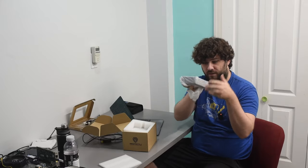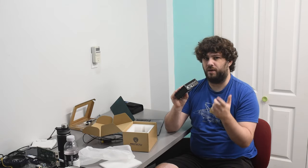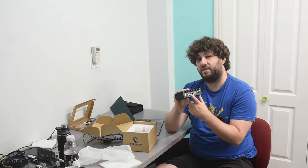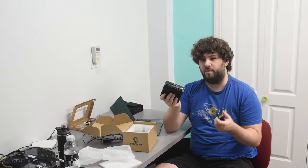Here it is. It looks pretty much identical to the FW-4B I've been using for a few years. It's got a 12 volt DC barrel jack and four RJ45s. This one has four Intel i225 v3 two and a half gigabit NICs. The slightly cheaper FW-4B has Intel gigabit NICs. On the other side you've got USB 3, headphone jack — I don't know why you'd want that on a firewall — two HDMI, and an RJ45 COM port. This is the Cisco-style terminal port, useful if you don't have a keyboard and mouse handy.